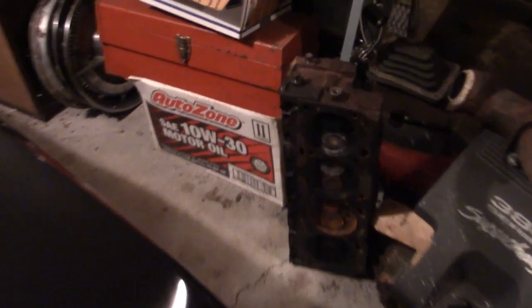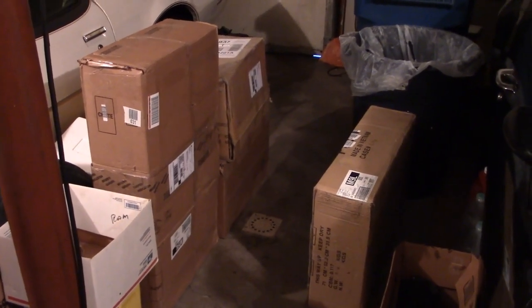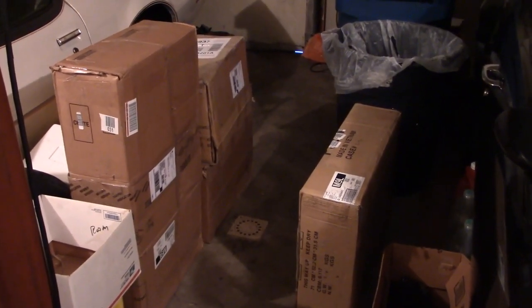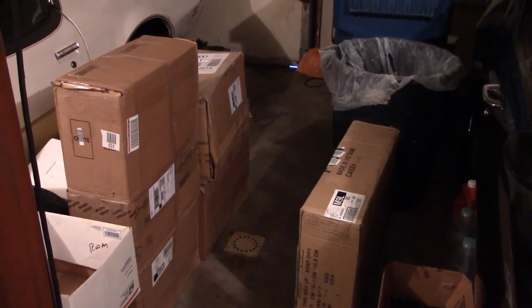There's the driver's side head with cylinder number five right there. UPS just rolled through and dropped off some new parts for the 455 — wonder what's inside, guess you'll have to wait until later to find out. That about wraps everything up for right now. Sometime next week I'm going to call the machine shop and get this block down there so they can hot tank it, magnaflux it and check everything, even do a sonic check. My worst case scenario fear is that the block has a crack where that cylinder is.